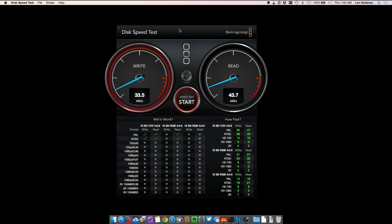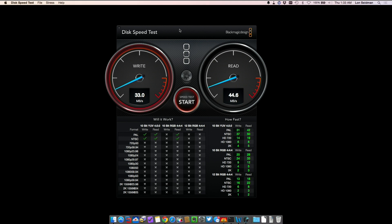Let's take a look at some benchmarks and see how the drive performs on the network. In the Blackmagic Disk Speed Test, which is what we test all of our drives with, we're getting about 35 megabytes per second on the write side and about 45 megabytes per second on the read side. I'm seeing slightly better performance when I run it on my Windows machine on the write side. What was interesting is when I connect to the drive using the Mac file protocol, the performance takes a hit — the write speed does okay, but the read speed was only about 12 to 14 megabytes per second, which is really odd. When I switch the Mac over to the Windows SMB protocol, it runs a lot faster. I think there's probably some glitch in the embedded software — I'm going to let Seagate know about this. So in the short term, if read performance is really important and you're running a Mac, you'll want to connect via SMB to get the speeds shown here. Otherwise you're going to see pretty slow read speeds, although the writes were not really impacted — very odd.